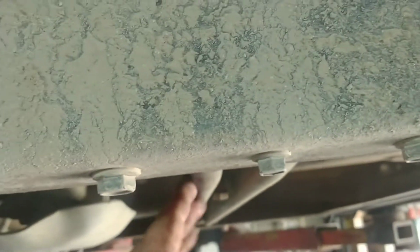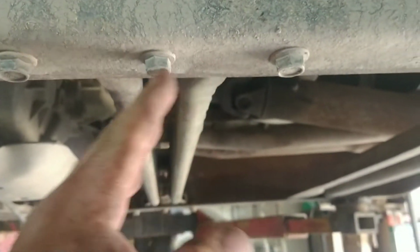Any used vehicle. Now these things, the price is getting up there on them. They're worth more and more all the time. They're appreciating in value, as long as there's something left to fix. I'll come over here and I'll show you some spots. This place here where the torsion bar goes across, they like to rust out in this area right there. This boxed in portion right here where the frame comes down and makes a curve, this likes to pack in junk, and they'll rust out in this spot.